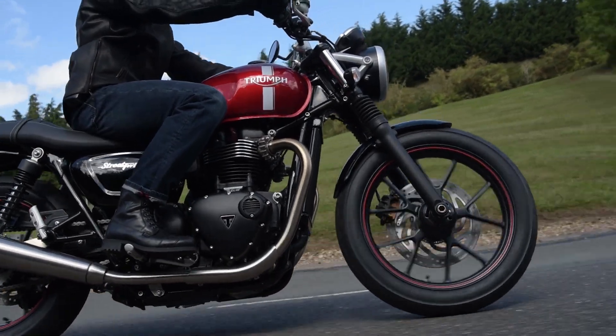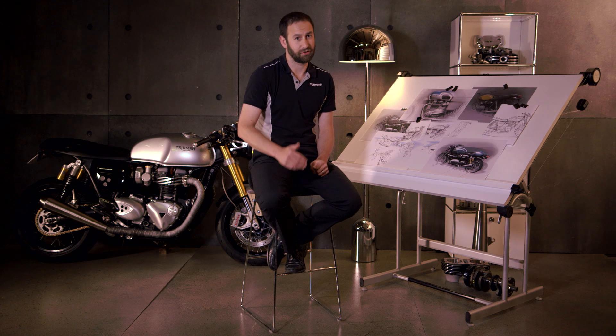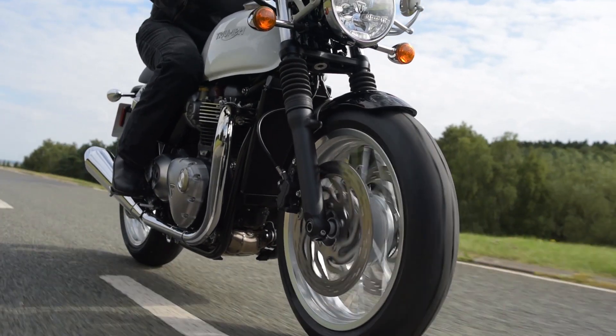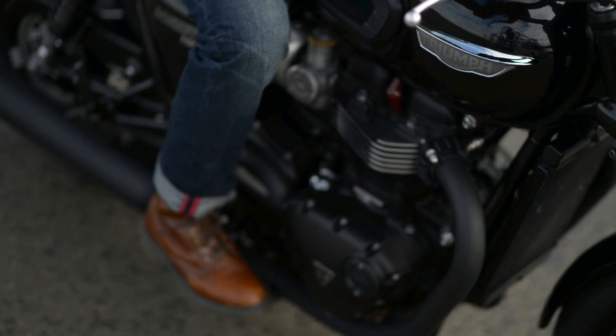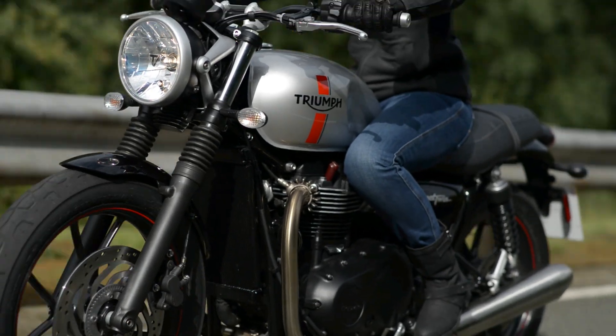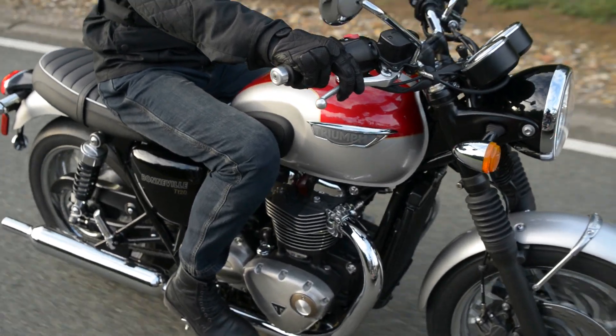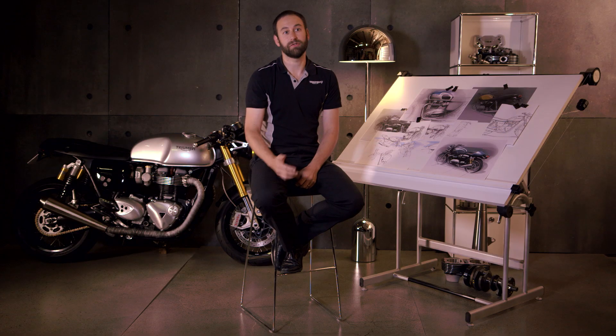There was some modern technology we needed to involve in this project right from the outset, but the challenge was to integrate it without impacting the overall lines, size, and styling of the bike. The best example is liquid cooling — we've gone to a properly water-cooled head and barrels, which was necessary to meet emissions requirements and deliver a more refined ride. Liquid cooling brought several challenges: we've mounted the oil-water pump internally in the engine to keep it hidden, and we needed to package coolant hoses and a radiator on the bike. The radiator is positioned in the same place and similar proportion as the previous oil cooler, so the overall look hasn't fundamentally changed.